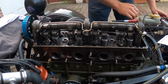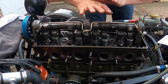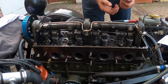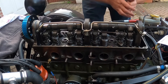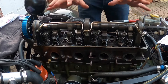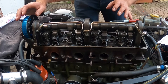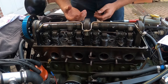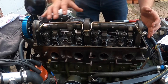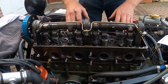I shall repeat for stage 3. Stage 3 requires 83 Nm after 20 minutes, so this needs to settle for 20 minutes. Stage 4 is after 15 minutes of running at around idle speed — about 1,000 RPM — and that will be set to 115 Nm or 85 ft-lbs of torque. I haven't changed the position of the camshaft during this time the head has been off, so when I put the timing belt on it should be exactly where I want it. If I'm going to leave this overnight, I've put fresh oil all over this to prevent corrosion, and then I'll put the cam cover on just to protect it even further.